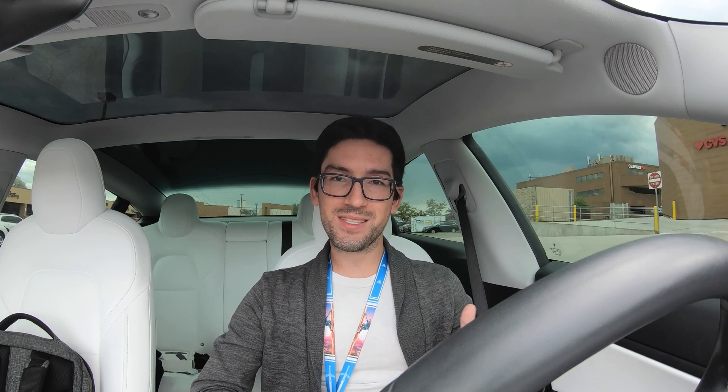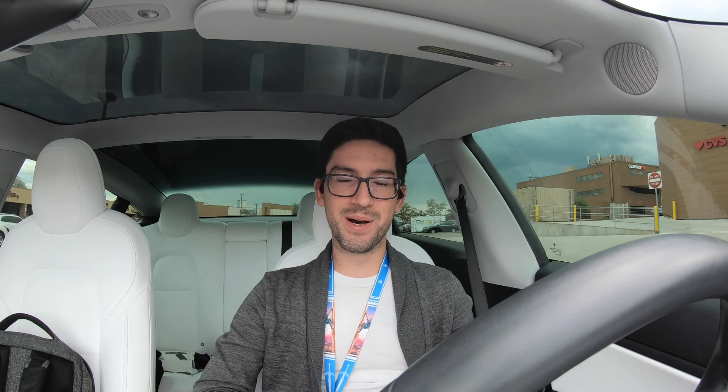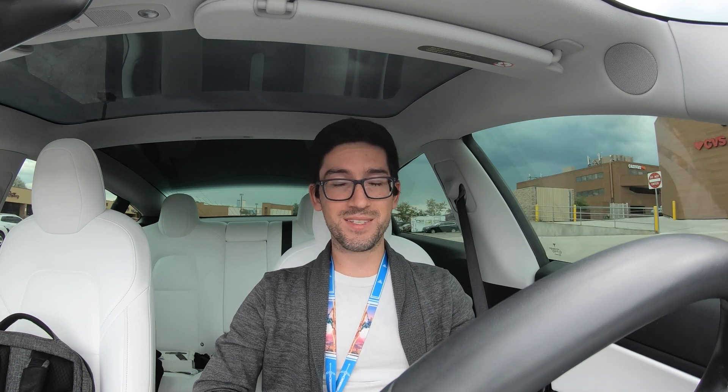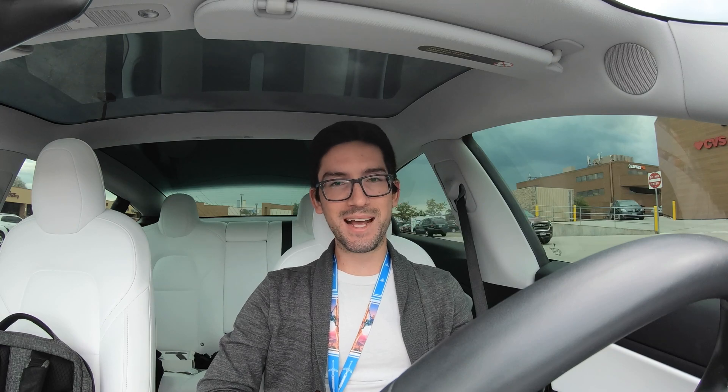The all-wheel drive variants have power biased toward the rear, so you'll want to rotate these tires much more often. I do it every 4 to 5,000 miles to make sure they're wearing evenly. If you have a rear-wheel drive version, I'd probably do it even more often since your rear tires take the brunt of the power. My recommendation is every 4 to 5,000 miles instead of 10 to 12,000 — that gap would worry me about uneven wear and major defects. I hope this video helped. Please smash that like and subscribe button, and I'll see you in the next video.